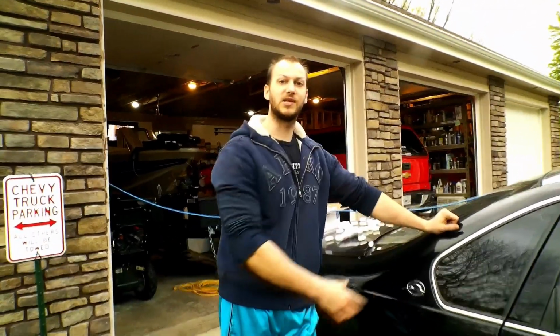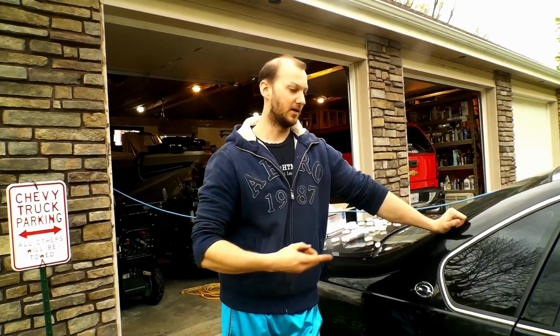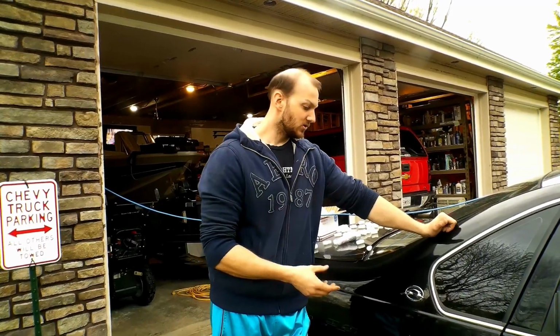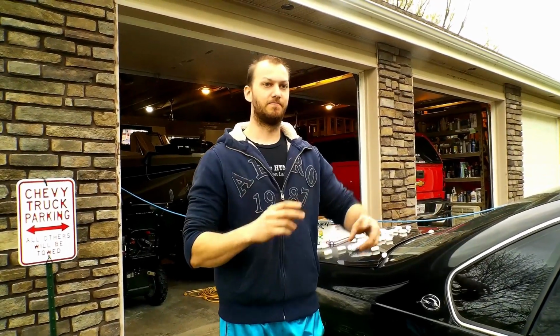And what that does is push the rear wheel back into the center of the wheel well. I'm OCD. It helps with wheel hop. It helps with, I guess, some 60 foot, but I did it because it just helps with my OCD. So when you bring that rear wheel back, you push that rear shock back even more, so your angle increases even more from where it mounts on the body.